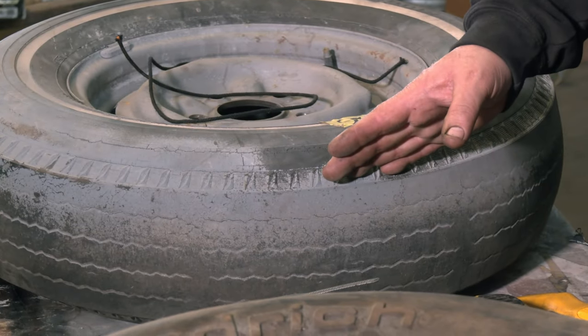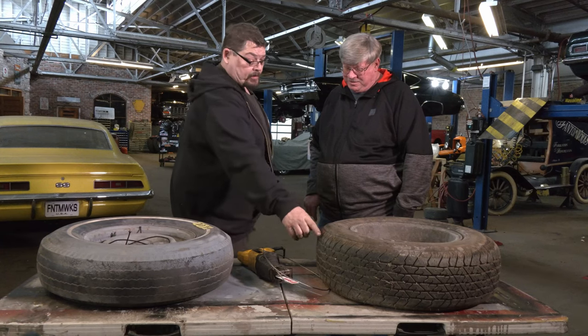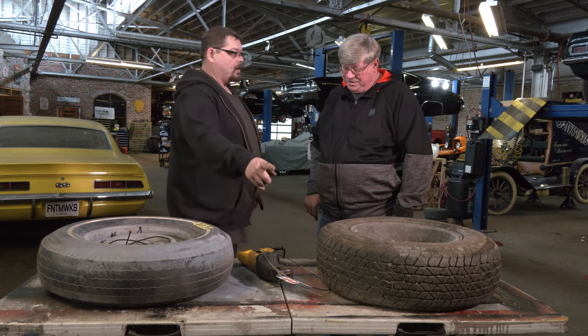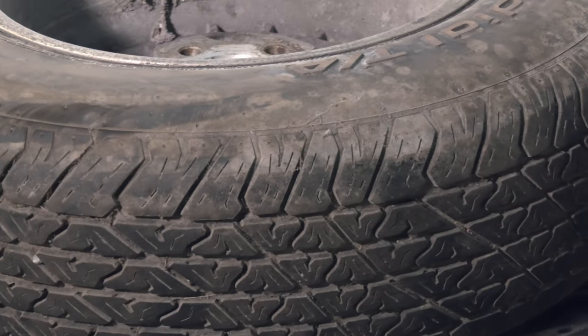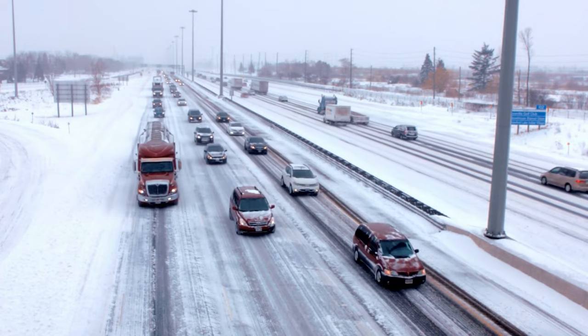There are sort of unilateral lines — you almost never see that unless it's a commercial tire made for super high miles. Pretty much all modern tires have open and closed shoulder. A closed shoulder has no grooves in it to let water out. An open shoulder has grooves in it to let the water out. You always want that — look at any four-by-four tire for mud and snow. They all have big grooves on the side to throw as much stuff out from underneath the tire as they can.